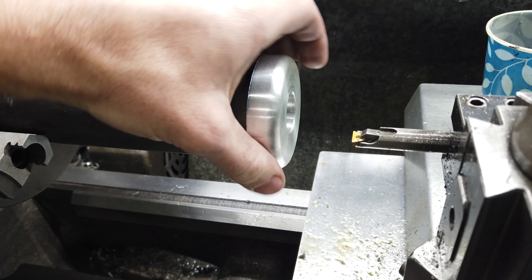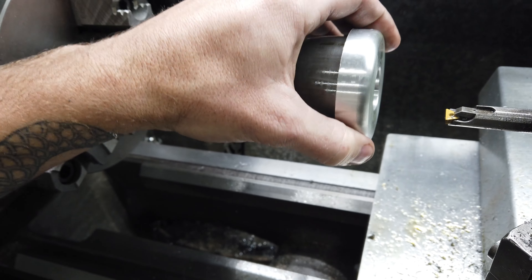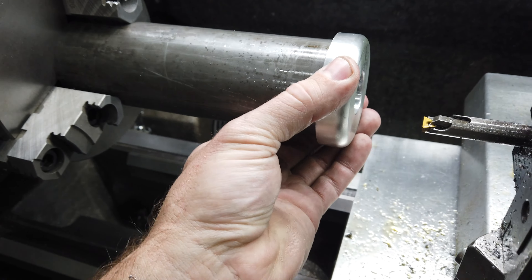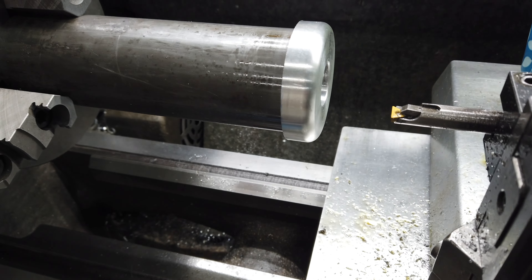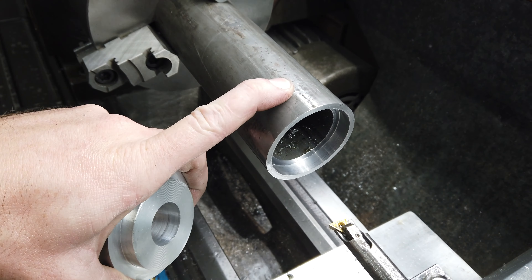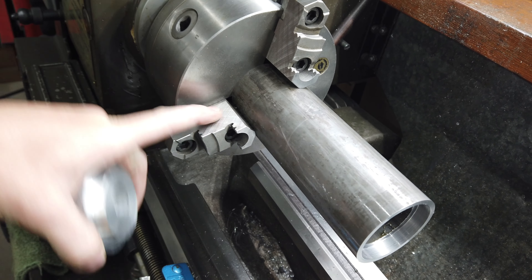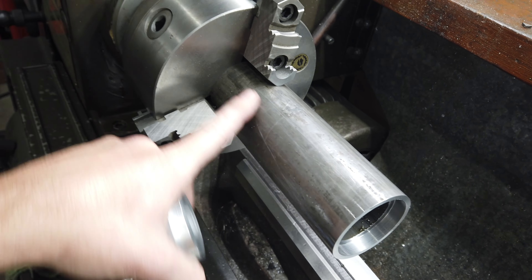This is what I've been looking for — if you try and pull it out too fast it gets stuck, which is exactly what I want. I could actually give you dimensions: it's a thousandths difference, so just a great fitment — it's not going to move or anything when I'm doing the external cutting on this and when I put it in the fixture. Very happy with this end. Now I need to flip it around and do the other end. I know this is way too much stick-out, but the only other chuck I have has a big back plate and it's not centered — it would've taken too long, so I'm just being very careful.